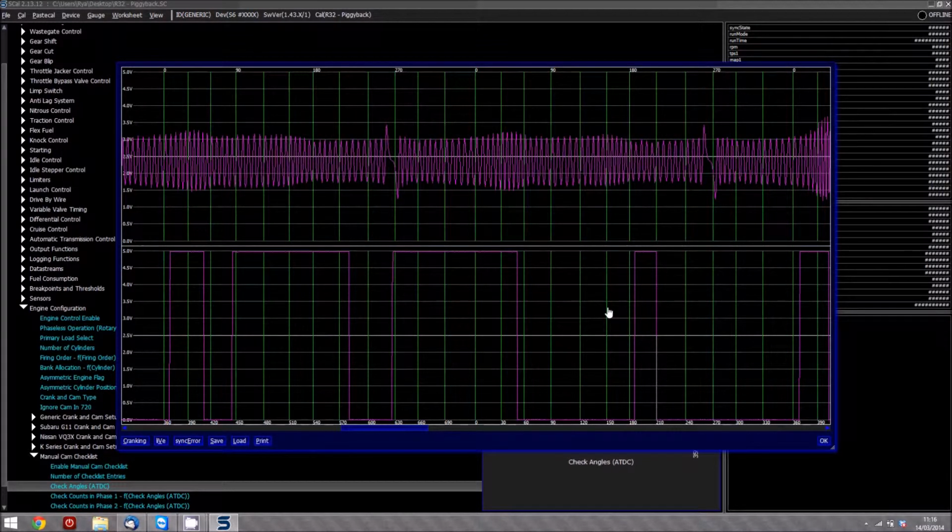Now, the difficult thing here is that one of the teeth is crossing over right in the middle of the two cycles. So what you need to do here is be careful on the edge which we trigger off. The most sensible edge, looking at this, would be to go on the rising edge. Because if we were to say at 300 degrees, looking at the top scope here, and then see the 270, in between the 0 and 270, that tooth is constantly on the cam. So if we were to look at the area of around 330, in the middle of the 270 and 360, what you want to do is decide, do we want to be triggering off the rising or the falling edge?